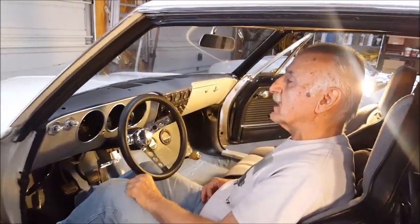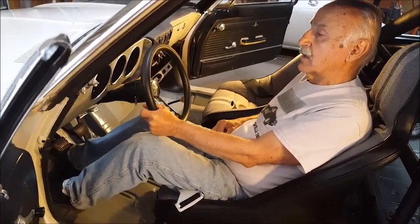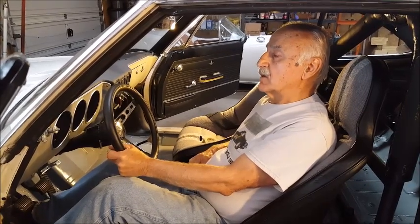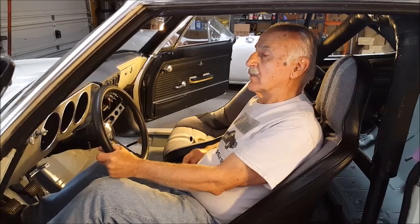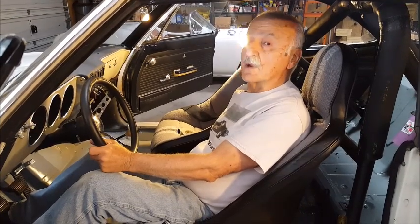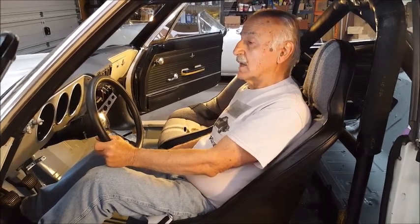It was an interesting situation that this car, on my return run, I had the cylinder head blow out on the left-hand side, number 2 cylinder. I was just entering the third mile, and because we had an overheating condition on the initial run, apparently the engine was somewhat damaged, but it was running a lot cooler on this particular run, so I raised the boost from 20 to 25 pounds, and we were probably doing close to 180 miles an hour when all of a sudden, just as I entered the timed mile,